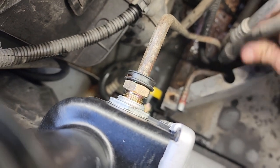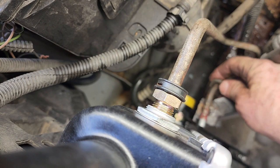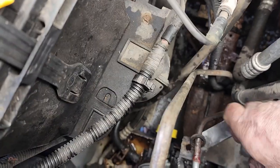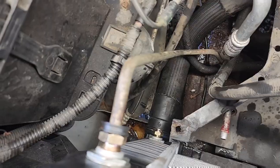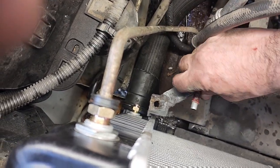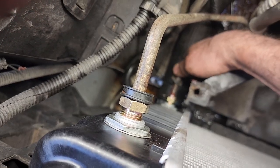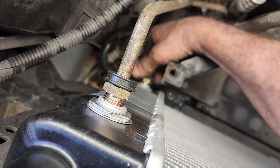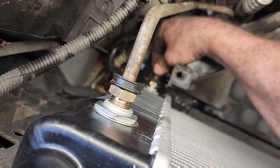Let's do that to the other side — the bottom one here. This is filthy too, so let me get my air hose, blow it out clean. I just got done blowing that out. Before I put this on, let me put that bottom hose in. I just put that hose back on the bottom rad hose. Now I'm going to take the bottom transmission line and run it in here — I'm pushing that in. There's that click. And then you push the retainer on top, just spin it, make sure it doesn't come off. And that just keeps it from popping out.